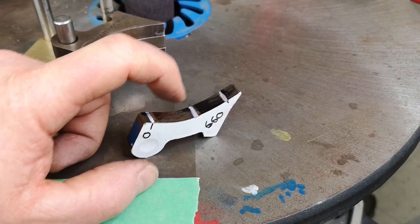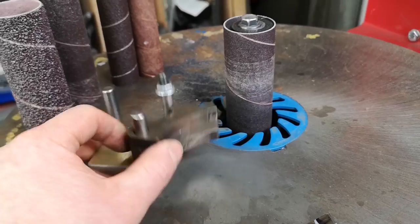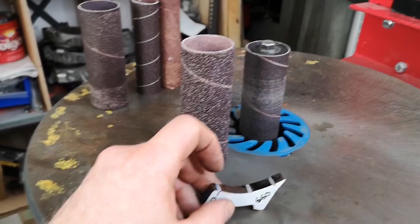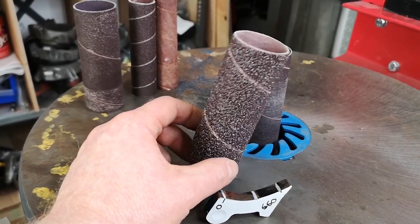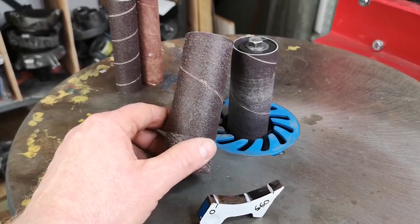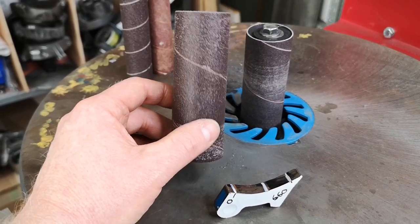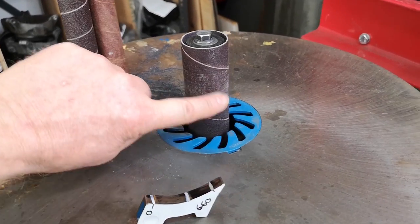We have CJ's ramp - not touching this portion, we're going to grind this portion. And this is what I used to grind out the angle on the ramp. First I start out with the coarse drum to get into the groove of it and take most of the meat off, and get about probably a quarter of a millimeter away from the line that I'm going to draw.